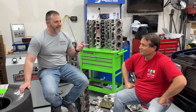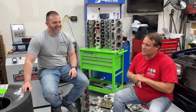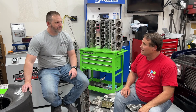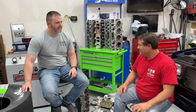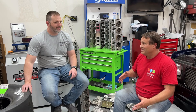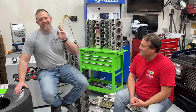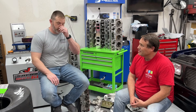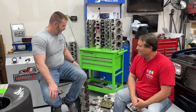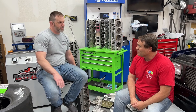Nick's going to make a prediction on the best head for peak power and best average power. Predictions are a sure way to look foolish on dyno testing, but I think the ProMax 290 will make barely more horsepower than the AFR 265. I think the 049 on the low end of the tach — below 5,000 — is going to compete with all of them, but that's just my experience with these combinations. He actually dynos quite a bit, so he has a lot of experience with that.